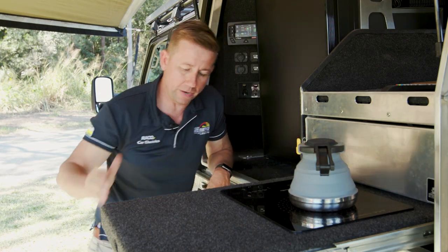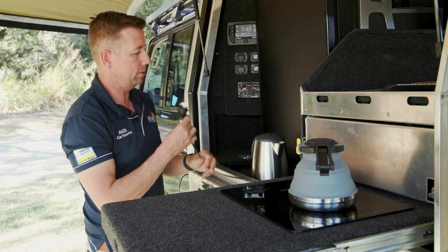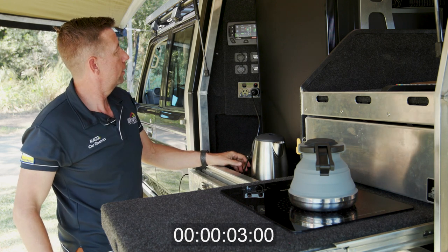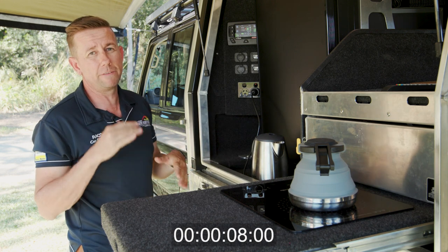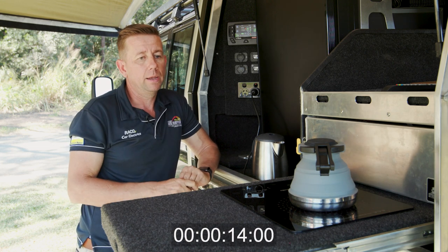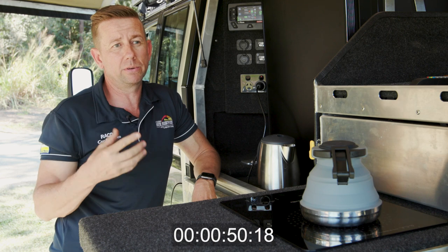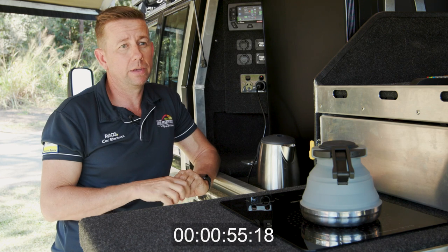That one's all boiled now and we've shown how good inductive is. Down here I've got Old Faithful — a Sunbeam kettle — again with half a litre of water in it. We'll whack it on and see how she goes. Straight up to 153 to 160 amps, so very similar draw. We've got the stopwatch running. This works differently — it's just got an element inside heating up and boiling the water, which is why I believe they're a lot less efficient.